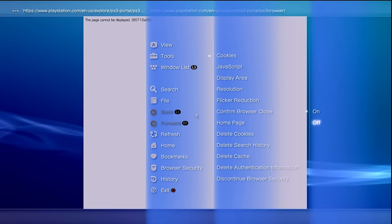Once that's all done, close out. The next important thing is to keep your flash backup somewhere safe. Make a new folder, label it with the serial number or something like flash backup, and bring your dump.bin in there. Save this backup somewhere, upload it to cloud storage — because in case anything goes wrong with your flash storage on your PS3, you can always restore it using a hardware flasher. Keep this incredibly safe. These are individual flashes per console — you cannot use this flash on another system.